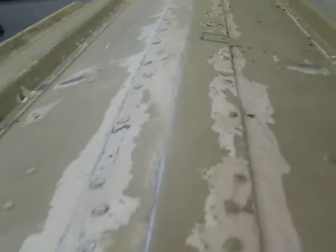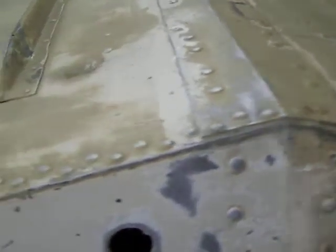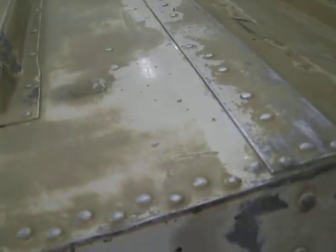The other thing that I noticed is on the keel here, you'll notice there's no silicone on here anymore. I scraped it all off. The previous owner had just siliconed the crap out of it. You'll go on this side, see all that extra silicone? I'm going to have to scrape all that off and clean it up. And once we get it all sanded down and taken care of, we're going to have to recheck it for leaks, because I have a feeling that a lot of that silicone was stopping some leaks inside this keel. So that is what's going on next.